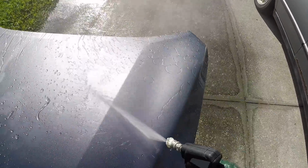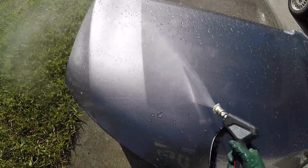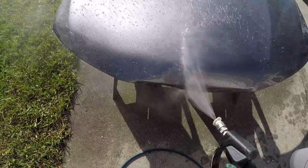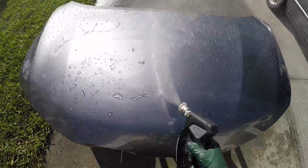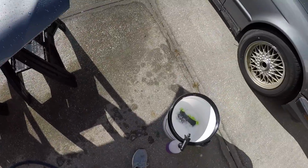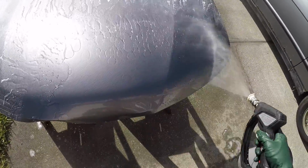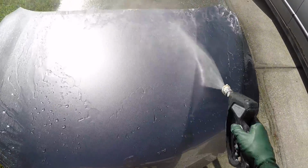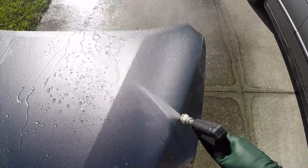And so what this test is going to showcase here, this is video evidence that yes, you do want to follow the manufacturer's recommended instructions for their product. You want to wait that 12 to 24 hour cure period if you can. However, if the paint happens to get wet, like you got a rainstorm and you've recently applied ceramic 3-in-1 to the paint, it's still going to be able to perform at a very good level. Okay, so I've reapplied Poorboy's Strip and gone over it with the wash mitt. You can see here we're still getting a very high level of repellency and survivability out of the product, even though we haven't given it any sort of curing time.